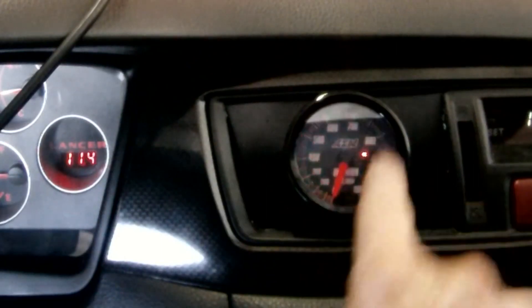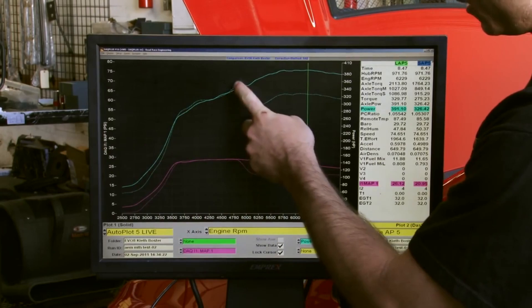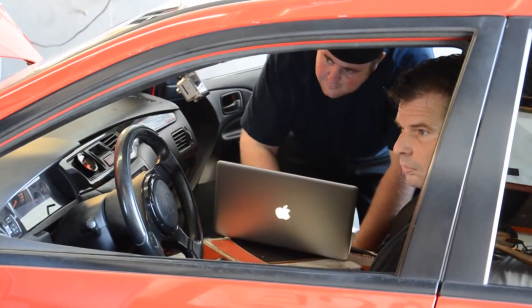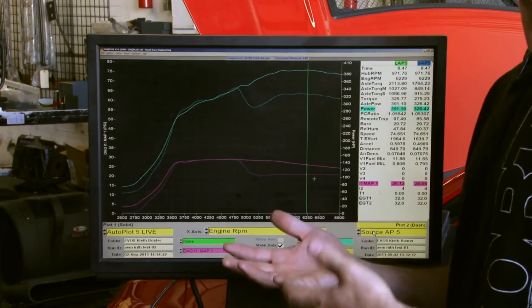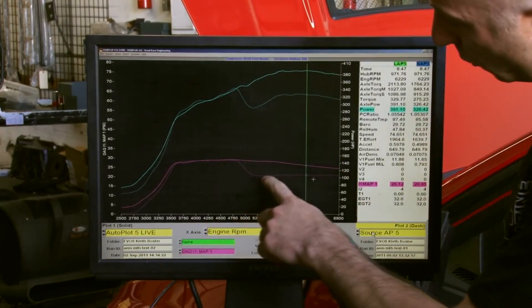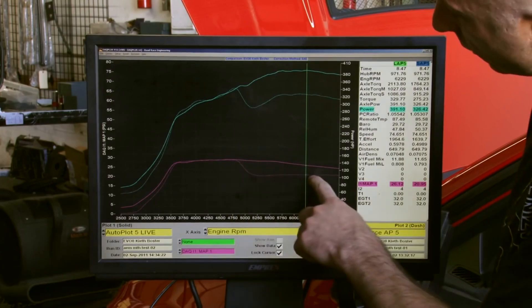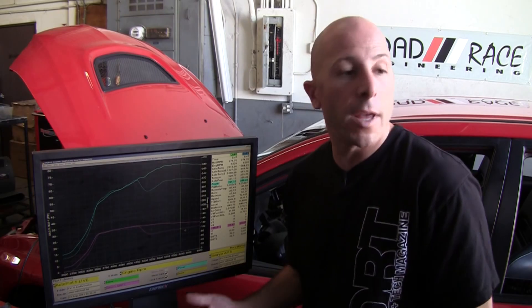Here's the data from the run. You'll see the horsepower coming up and being very high, but then it drops down. What's happened is our fail mode created the secondary strategy of lower boost, less timing, and increased fuel. You'll see that with the less boost shown by the dotted pink line, but then it continues all the way to redline with no detonation — completely safe.